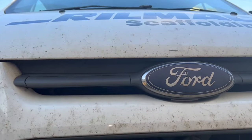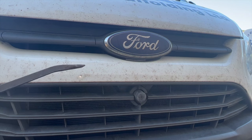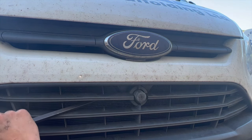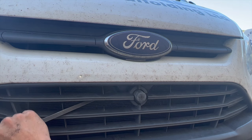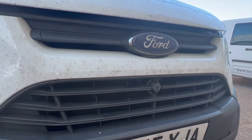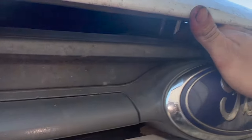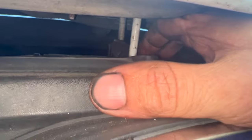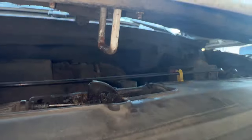As you can just see, it didn't take much at all to pop that up. The next part is really simple — just lift the bonnet up and reach in. You can see the safety release there, and just simply push that back and you can pop the bonnet open.